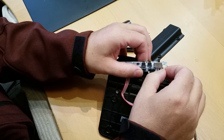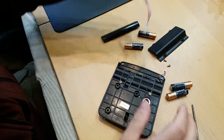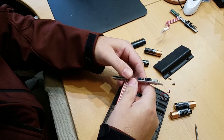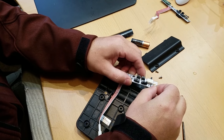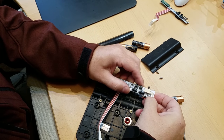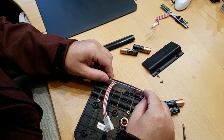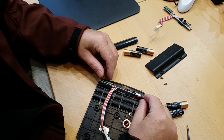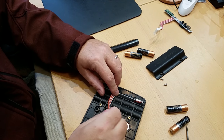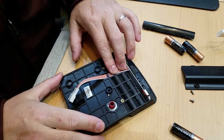We'll go ahead and take that out. I'm going to remove the power — be very careful here. Pull that out, pull that out here. And then we can remove the old PCB. Here's the new one, and we're going to do just the opposite to install it. I'm going to put the power cord in — it's very, very small so make sure you get it lined up. It'll snap in. Line up the rails here, and tuck the power and ground cord back in. This cord will snug in there — nice and tight.